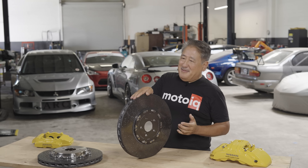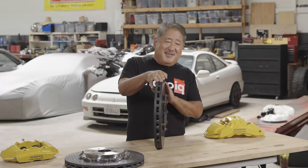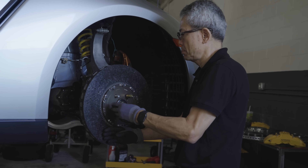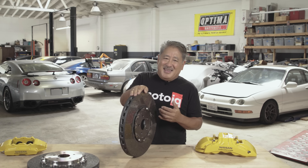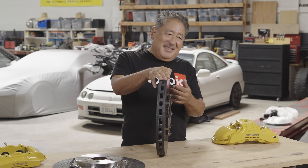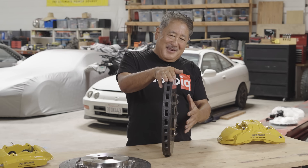The way these are made is really unique. Carbon fiber and epoxy resin is laid up in a mold to make a blank, which is the approximate size and shape of the rotor. The blank is inserted into an autoclave with a block of silicon in the middle, and the atmosphere in the autoclave is replaced with a controlled atmosphere eliminating oxygen — creating what's called in chemistry pyrolysis, a chemical reaction in the absence of oxygen. The atmosphere is usually methane, which has a lot of carbon in its constitution. The autoclave is then heated up really hot under a lot of pressure, and the epoxy and carbon sublimate out, leaving a carbon matrix. Then the silicon in the middle melts and gets absorbed through the whole rotor blank, kind of like a candle wick. This process takes a few days and you end up with this.